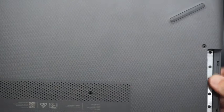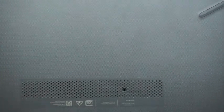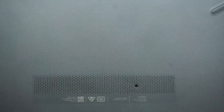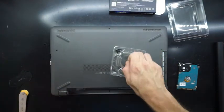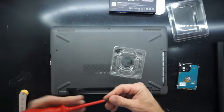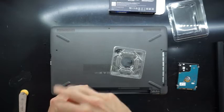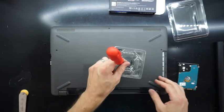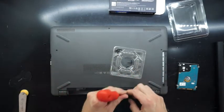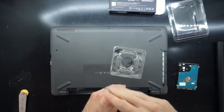So I'm just clipping the body back on. Basically you start with the ports side, getting the cover on it first where all the plugs are on the left hand side, and then work your way around from there. From here it's pretty straightforward — put in the two screws underneath the battery, put in the exposed screws, and then put the four screws underneath the rubber feet. Also remember to put the DVD burner back in, and then from there you should be right to reinstall Windows.